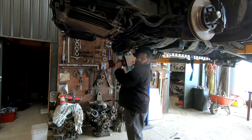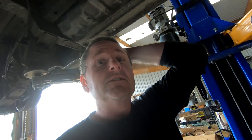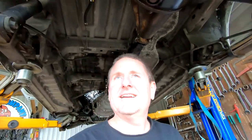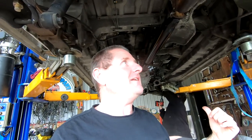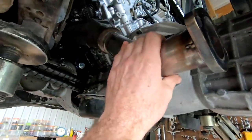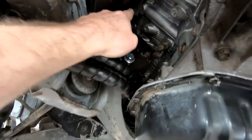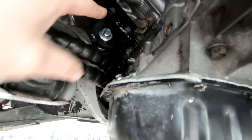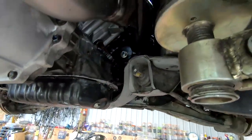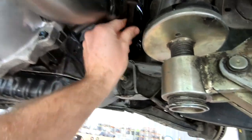How many ugga-duggas to do it up tight? Too many apparently. He's been getting his big gorilla hands and squeezing them into little spaces to fit up the exhaust manifolds. New bolts, engine mounts are painted with new rubbers pushed in, spiral wrap around the oil cooler lines, and the gear linkages have had a whole lot of new bushes and pins put in to try and make them firmer and nicer.